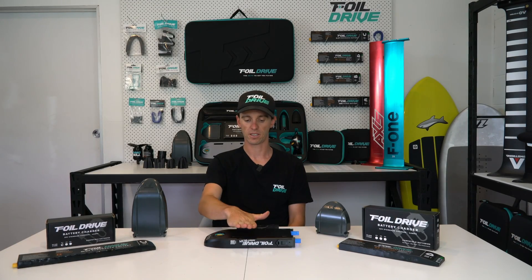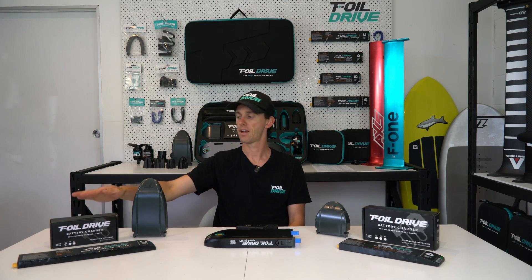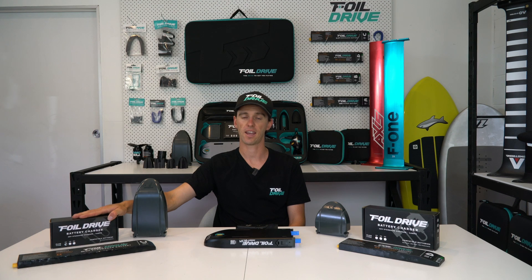Let's come back to: you've bought your Assist Slim. If you have your Slim Performance battery, your charger, and your nose cone, you're good to go. The systems are pre-set from factory to use a 40-volt architecture in terms of programming the box and the controller. If you decide to get a Slim Endurance battery, you need a 28-volt charger — you may already have one from your Gen 1, otherwise you'll need to purchase one. You've already got the nose cone. Now here are the requirements when using either of these batteries with your system.